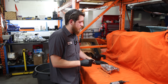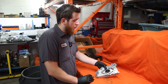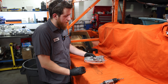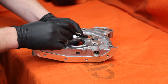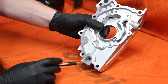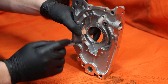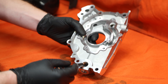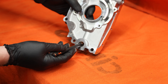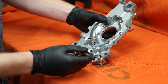Next up, we're going to port this oil pump. It's pretty much just a mild port — all you're doing is rounding out sharp edges at exits and entrances. It's pretty straightforward. Down in here we'll be smoothing this out, making it smoother to enter. On the pickup side we'll be smoothing this out so it's a little bit smoother to exit, as well as inside this port hole here — this area on the back side can be ported quite nicely.